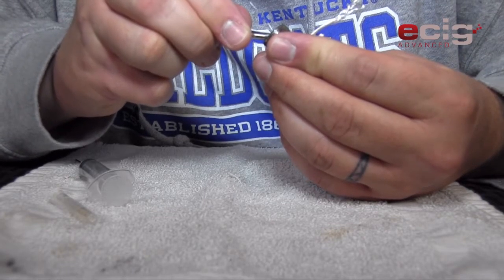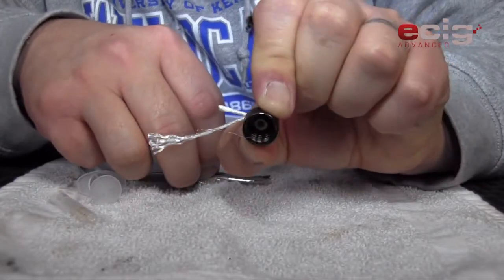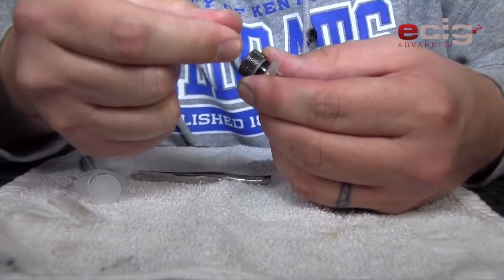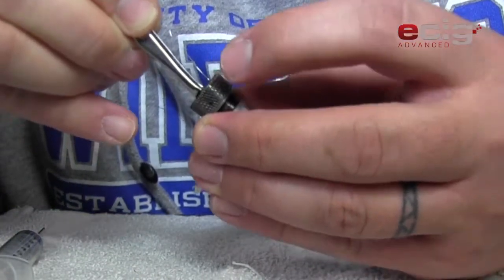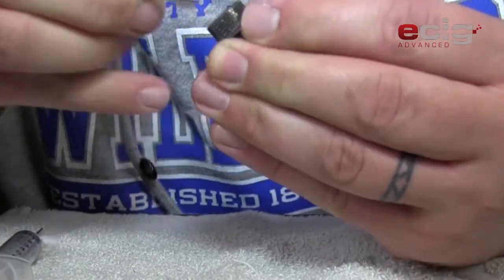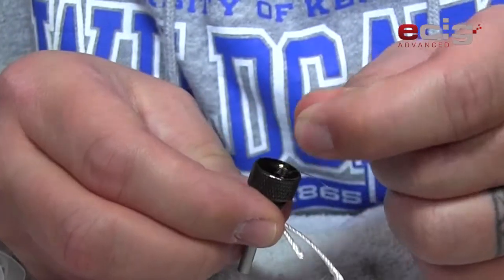I'm going to tell you right now that I'm going to edit this video, so it's going to look like I got it on the first try — but I guarantee you it didn't. This is a pain in the ass, but get yourself a good pair of tweezers and you can get it down in there. Alright, so we've got that wire tight and this wire tight. You have one wire sticking out through the grommet hole and one wire on the outside of the grommet hole — that's your ground and that's your positive. We're just going to take our tweezers and reinsert that center post. And there we go — you can see it is in there and we have our positive and our negative.